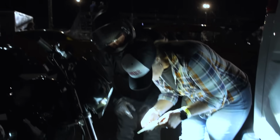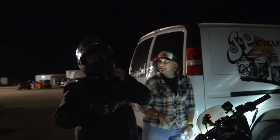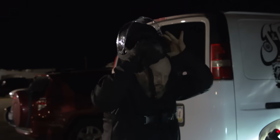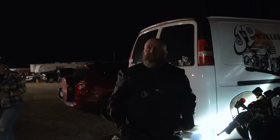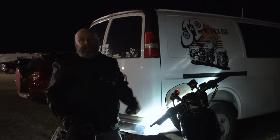.873 at 83. Yeah, really left really soft. We're already almost 2 seconds faster than what we were. With a soft leave and just the motor build, we knocked 2 seconds off an eighth mile time. That's pretty great. So that's a high 8. If we leave harder and spray it, maybe we can spray it into the low 8s. So I say we throw the bottle on it and let her eat.